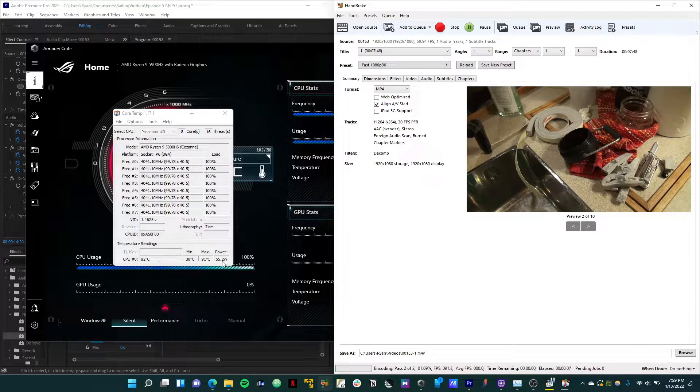You can see immediately the power jumps up to 55 watts. So we are now pulling 55 watts just on the CPU. Adding a little margin for the display and the rest of the laptop itself, we could be pulling maybe up to about 75 watts total, which is quite a bit of power.